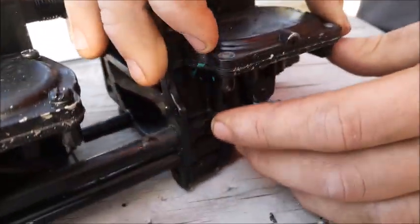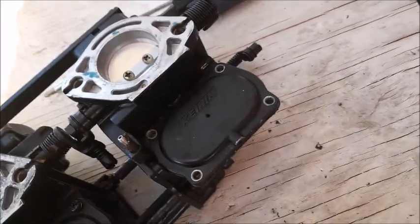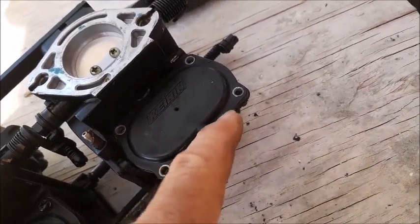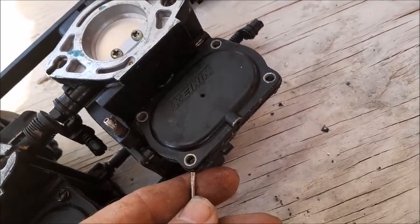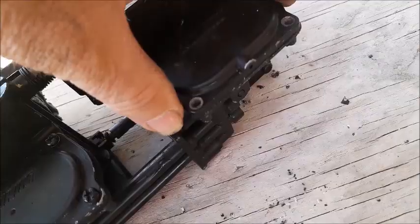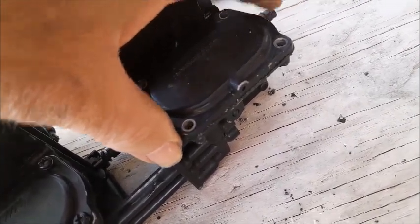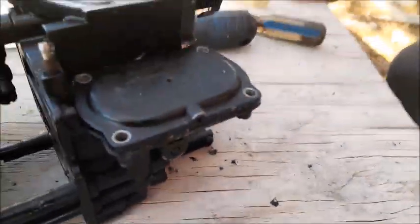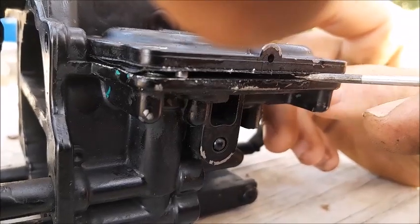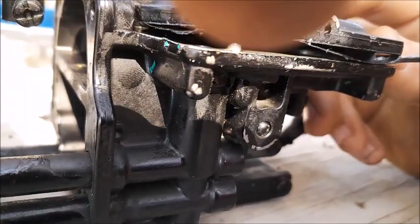We're taking the four screws out of this other cover plate. It was a little hard to get off — this is probably the first time this came apart. We've got a super small screwdriver and decided the gasket might get damaged along the edges, so we went in right beside the bolt and were able to separate it right there. Now let's go ahead and take it off — very careful. Half the gasket may stick to the cover and half may stick to the body of the carburetor, so we don't want to tear it because we're just basically doing a clean out.